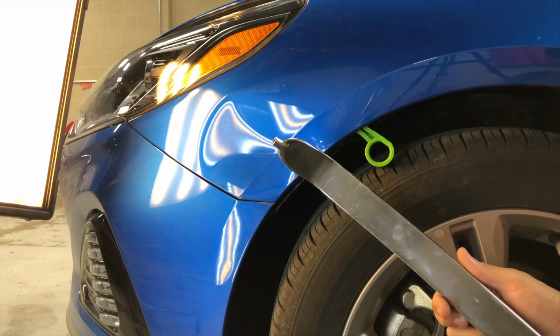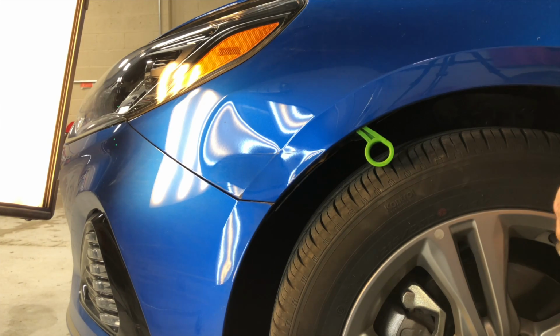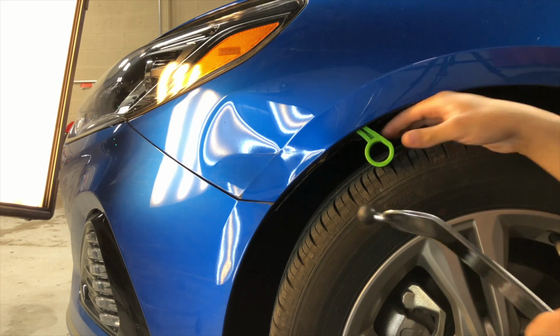Now the CarePoint tool had that bend, that 45-degree bend that they run. I can't get the dent dowel to get to that kind of angle, but that played a huge role towards the beginning because I had the perfect angle to actually repair that dent with the big round 1-inch balls that Dentcraft sell. So keeping both of them in your arsenal, you'll probably benefit.